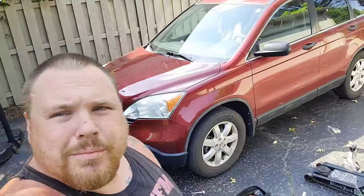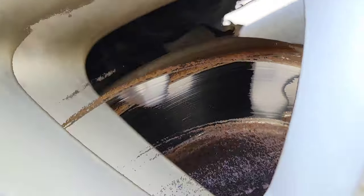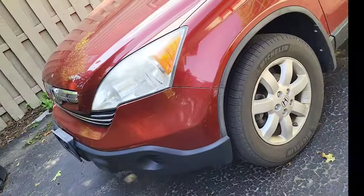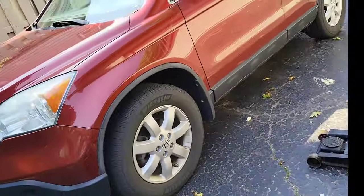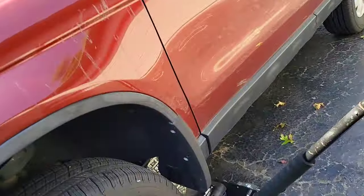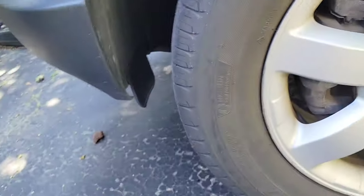We're gonna be doing the front and back brakes. The front rotors look pretty good, but the back rotors are a little bit more damaged — not a lot of surface area left there. Let's go ahead and get this jacked up, at least get the front brakes on there. Usually with the Honda CR-Vs, it's a 19 millimeter for the lug nut. Here's our little lug nut set — there's a 17 millimeter and a 19, so the 19 does work.